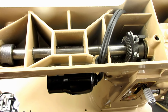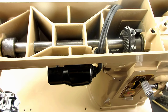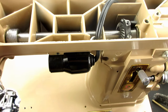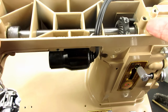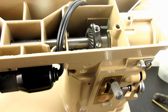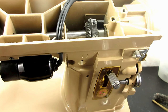dry a machine like this, you've drained most of the oil out. And these bushings have a capacity for a lot of oil. So there's 8, 9, 10, 11, 12, 13, 14, 15. I think you're getting the idea. On these type of oil port like this, let me move this over a little. I'll put the tube in there and just slowly start filling it up until I can see the oil up at the top here.